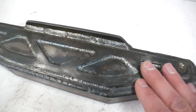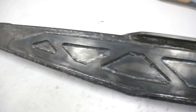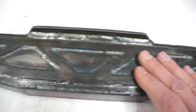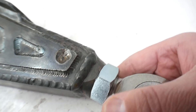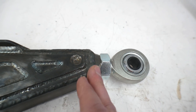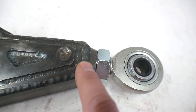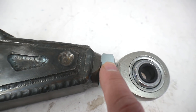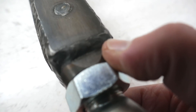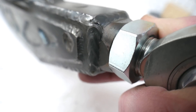That was a lot of welding but it does add a lot of strength, looks really neat, and doesn't add a lot of weight because there's no wasted material — that's why I put that on there. I also MIG welded the bushing. I now MIG weld these because when I used to TIG weld them, the heat would sometimes damage the threads a little bit. When I MIG weld it I don't have any problems with the threads, and it actually comes out really nice.